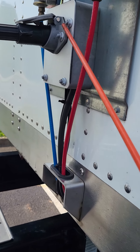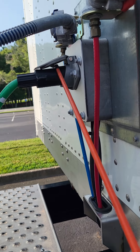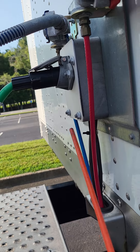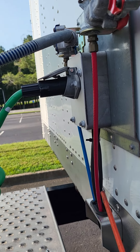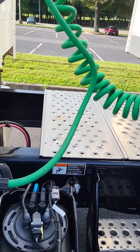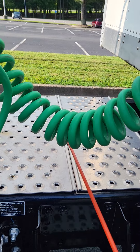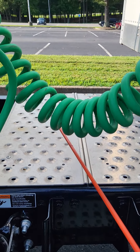The electrical box itself is not bent, broken, or cracked — not missing any nuts, bolts, or screws — and it is firmly seated and locked in place. All of my lines, my airlines, and my electrical lines, are not hanging on the catwalk. That is the statement you must say.